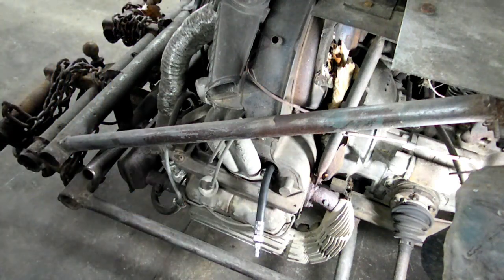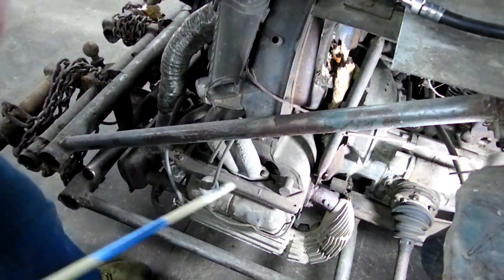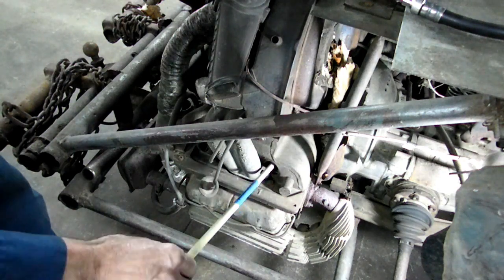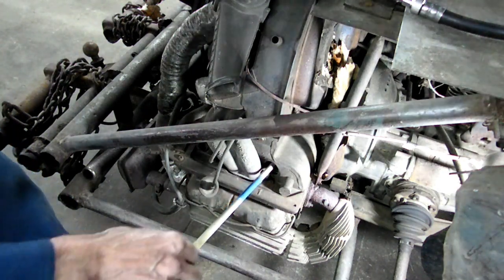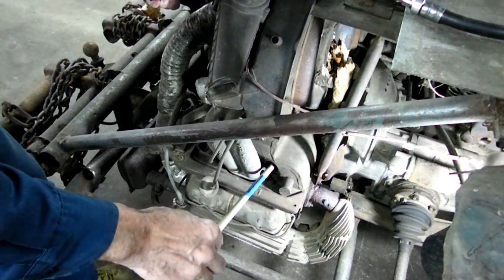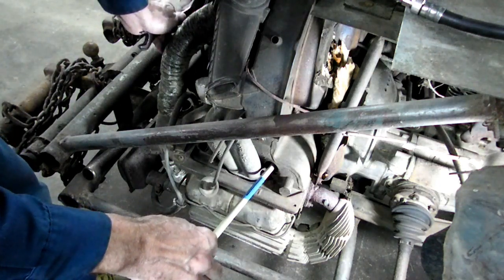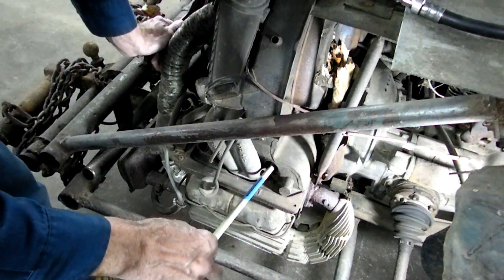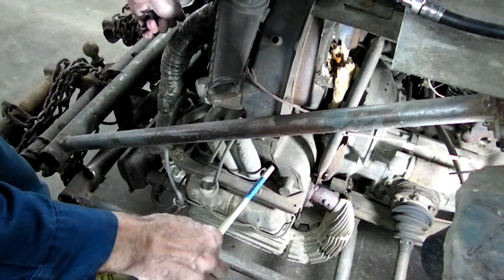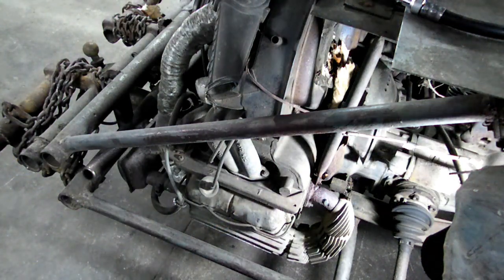I feel the pressure — that tells me we're coming up to top dead center. Now I'm going to remove that hose and insert a wooden dowel into the spark plug hole so I can know exactly when the piston is on top dead center. I'm going to rotate the engine and watch the dowel — it's moving. It went past a little bit. Right there, the piston should be right at the top of its stroke.